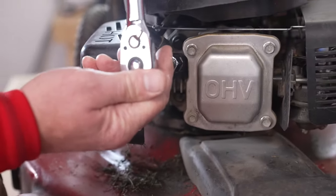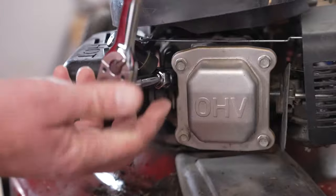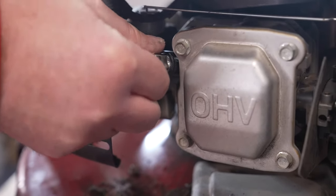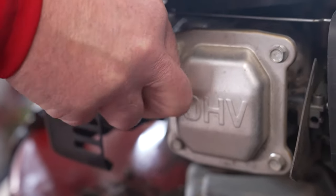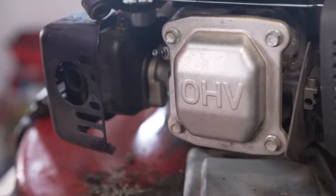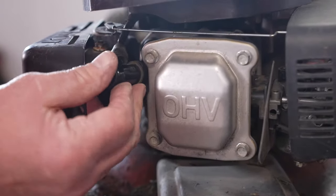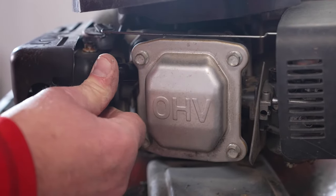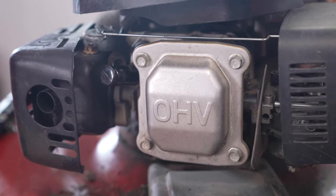You don't want to over-tighten, but you want to get a little pressure on there. Once you feel that washer sit, just give it a little quarter turn like that, and that's it. Then once you tighten it, you want to wiggle the socket — that gasket's going to hold it pretty well, so you may have to wiggle it a little bit and pull, and then it comes out. There's the spark plug installed. Here's the cover — when you push this over the top of it, you're going to hear a click once it goes on. You just replaced the spark plug on your lawn mower.